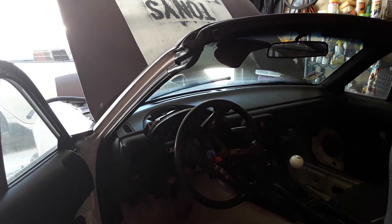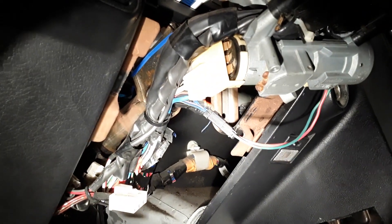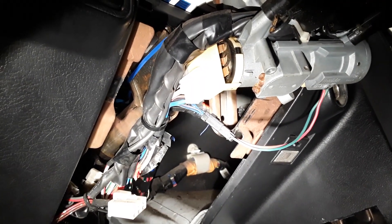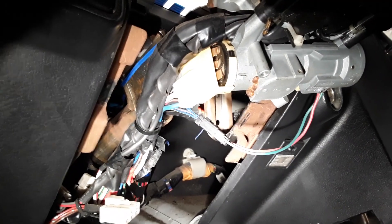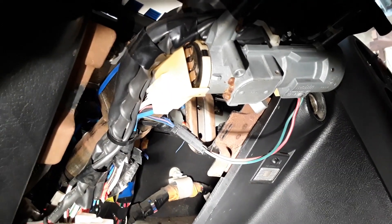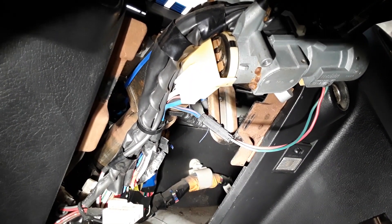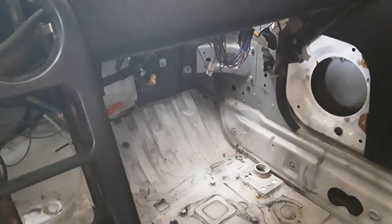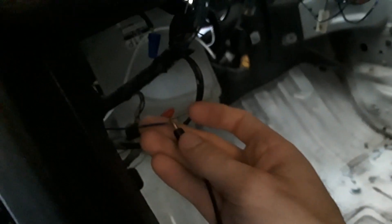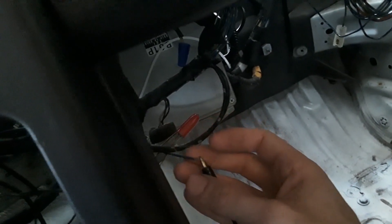The first step is to make sure you can get your old O2 sensor out, because if you can't, everything else is worthless. After that removal, the first step is finding a source of voltage for both the sensor and the display. You need a 12-volt line for both of them that is on only when the ignition is on, or else you'll end up draining your battery. I looked it up online — the wire we're looking for is mainly blue with a small black stripe, which should give us the 12 volts we need when the ignition is turned on.